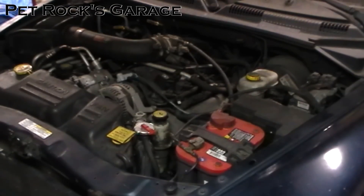Hey, this is another video by Petrock and today I'm going to be measuring and adjusting the front end ride height on my 03 Dodge Durango 4x4. This is something that you want to do prior to getting alignment to make sure that your alignment is correct and that the camber and caster is properly set by the alignment shop. Some alignment shops won't check the ride height like they're supposed to, so it's a good idea to do it yourself and make sure that the suspension hasn't sagged at all.